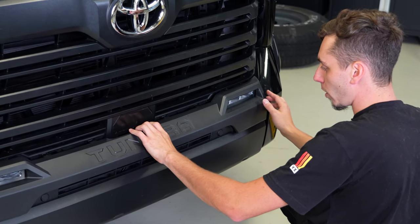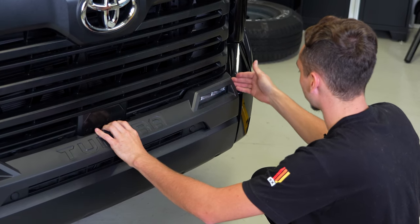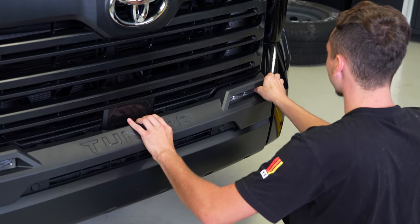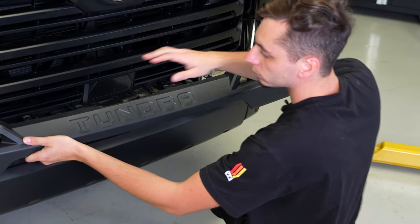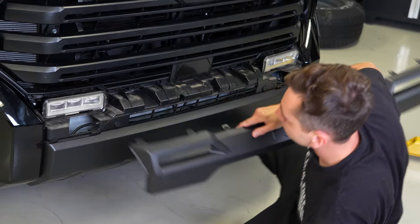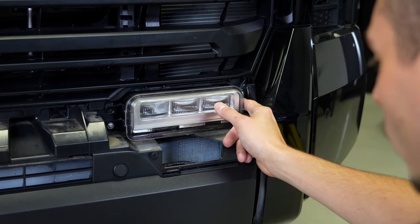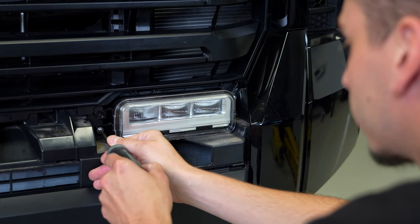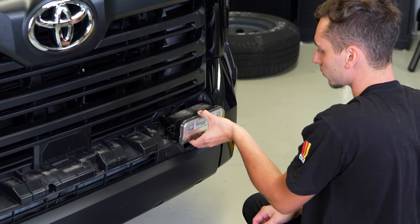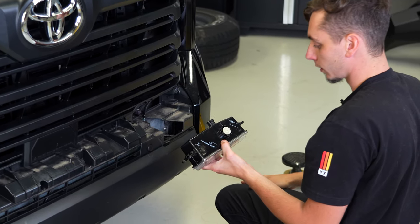While you're trying to get this out I'm also going to be pulling out on the center — it's going to kind of bow the whole molding or trim piece and give me a little bit more room to get that out without it scraping on the painted surface. Once you have that piece off your fog lights are easily accessible. There is a Phillips head screw, one on each side — go ahead and take those out, pull out the fog light, and unplug it. Simple as that.